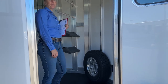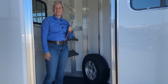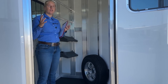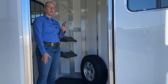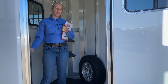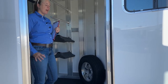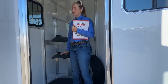The nitrogen filled is really nice because especially on colder days like today, where it starts out really cool in the morning and then it warms up, you know, it might get to the high 80s. It's nice to have the nitrogen filled tires. They do not expand and contract quite as much as regular air does. So if you can have a more stable PSI to begin with, and you don't have to worry about a cold tire starting out at a lower PSI, warming up and that PSI rising, that's when you face a lot of issues with potential blowout. So having nitrogen is a really nice option. People always worry, well, what if I have a low tire and I can't find a place that'll put nitrogen? It's no big deal. You can always put regular air in it. You're just not going to gain the same benefits from the nitrogen in that tire now. So you just have to know that it's not going to maintain that stable PSI like it did with the nitrogen. But always an option, always a nice option.